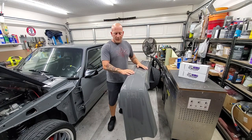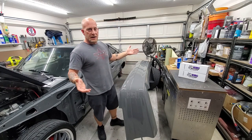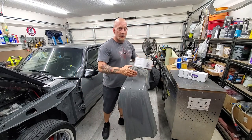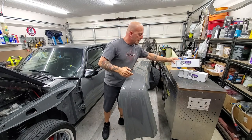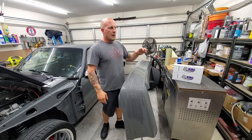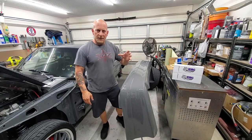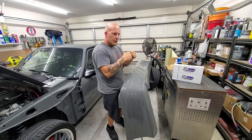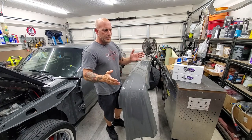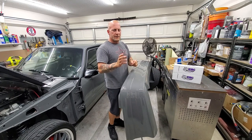There's really not much to popping this thing on — a couple little mods I'm going to do to make life easier on and off in the future. While the wheels are off, I stopped by UPR and picked up a set of springs, because right now I have 10-inch, 150-pound springs in the rear and I need to go up with the car just a little bit — maybe 3/8 to a half inch taller. Having it tucked real nice in the back with a nice stance is a cool look, but for functionality it's no good. I ran out of adjustment, so I figured let me just get a longer spring.